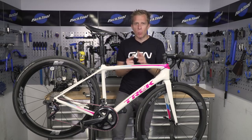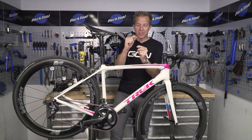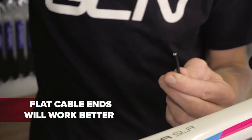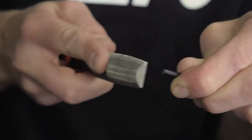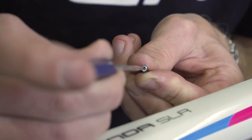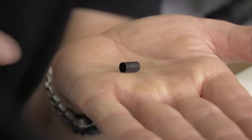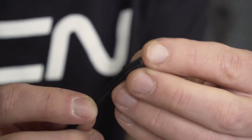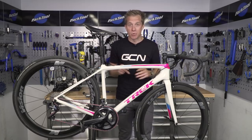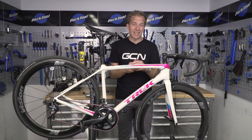We touched on cable length, but what about the ends of the cables? You want them to be as flat as possible. Give it a good chop in one smooth movement, then use a file or a grinding wheel to make sure it's ultra flat. Depending on your cable type, you can flush out the inner liner using WD-40, silicone lubricant, or a very lightweight thin oil to help the inner cable travel more easily. Alternatively, the best thing to do is get yourself new cables — both inners and outers. The difference from old to new is absolutely massive, and everybody notices the difference instantly.